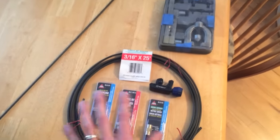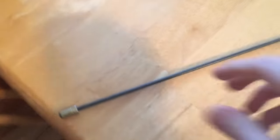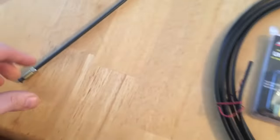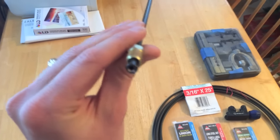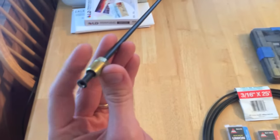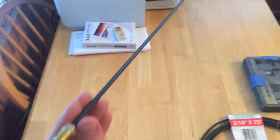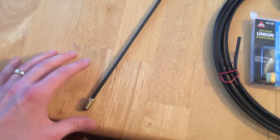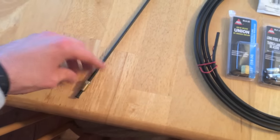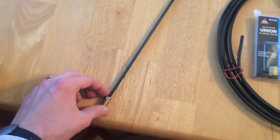Let's say you don't want to deal with any of this — that's above your head, that's not something you want to waste your time with. They actually make brake lines that are already pre-flared. You can buy them in different lengths and different sizes. Zoom in — you notice this one is already flared, it already has its nut, and again you will verify that it is metric or US standard. This one is a double flare, and with this you will have to go out and buy the union, but that's no big deal. You can buy several of these pre-flared lines with the nuts and connect them together, which is not frowned upon.